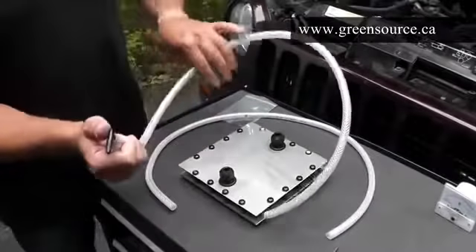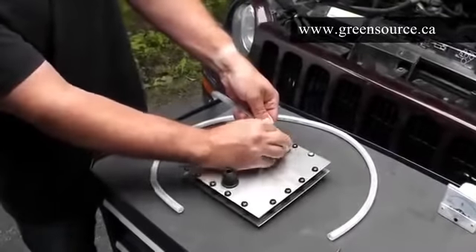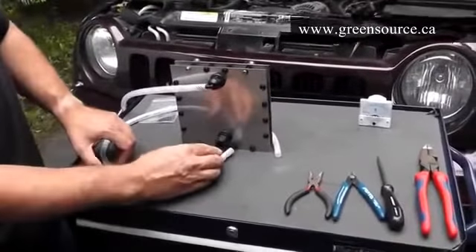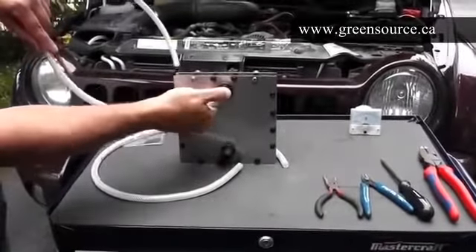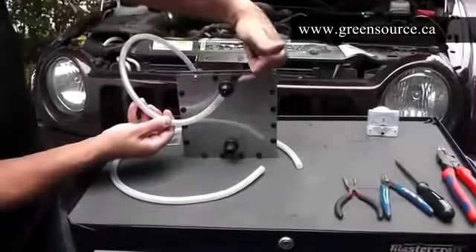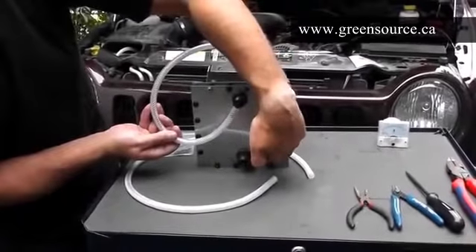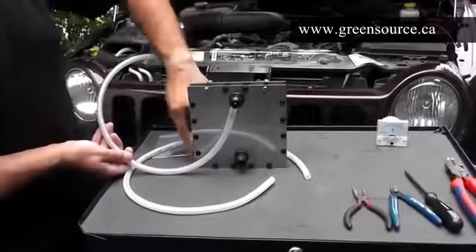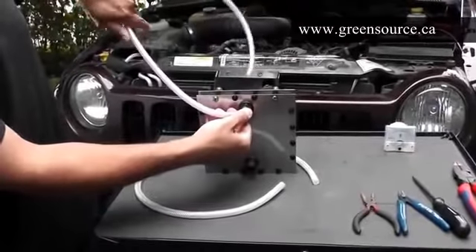The most critical is the upper hose. When sitting in the vehicle, the lower hose is connected at the bottom and the upper hose is at the top. If at any time this upper hose goes below the level of the nozzle, it'll lower the water level. The generator will no longer be full — it'll pump the water back up into the reservoir, and you'll have almost no water in the generator. In the worst case, the generator would empty right out and produce no output at all. So it's very important that with any dry cell, the upper hose never goes below the starting point.